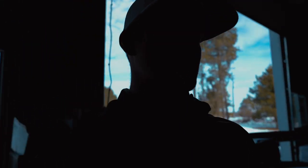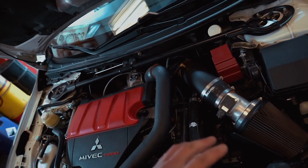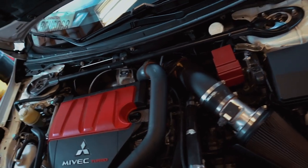I kind of feel like an idiot right now - I told you earlier the gate selector bushing is inside the car and it's not, it's on the transmission. So let's move on to the gate selector bushing and the shifter cable bushings. I already had the shifter base bushings in there so I can't really speak on whether those improved anything. Let's move on to the more important stuff. I'm going to have to remove a few things - probably my intake and this tube here - and hopefully that will be enough to get to all the bushings.